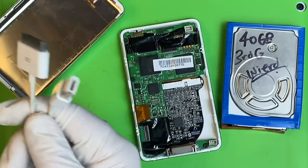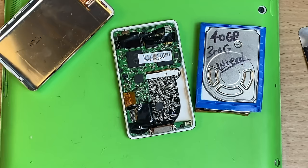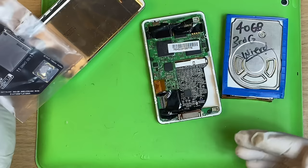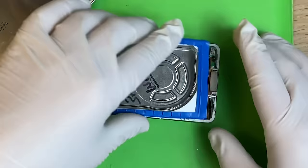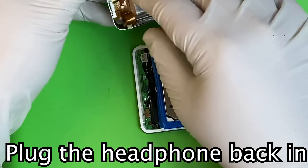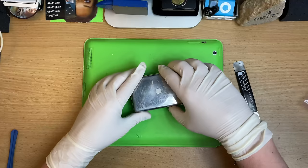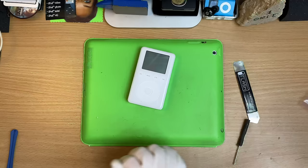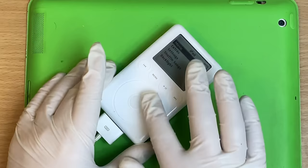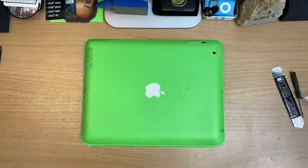These are beautiful but I'm going to do a video on how they're like the worst iPod to own — very pretty but very annoying. People have flash-modded these; there's an iFlash adapter for these older hard drive form factors. But you've really got to want this design to try the flash modding — it does work, it's just extra fiddly because of the Firewire dependency. My little test to know the hard drive is actually connected: if you can pick it up by the drive and it stays in, usually means it's connected. And this is the power of Firewire — it can run with no battery at all.